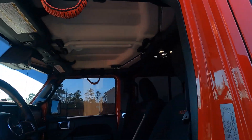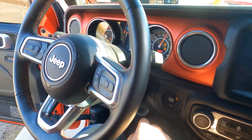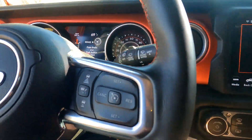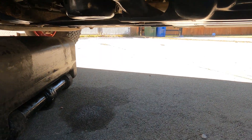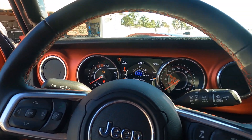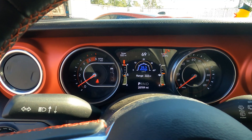So you don't touch the brakes at all — just go ahead and turn the ignition on. You can hear the pump — that was one. Turn it off, then do it a second time. There's your second one. Don't see any leaks. Go ahead, press in the brake, and there you go — no warning lights, no check engine light. Starts up nice and fine. Just make sure you prime your vehicle twice.